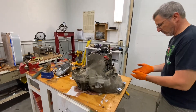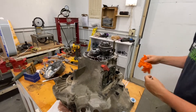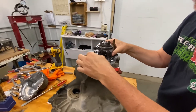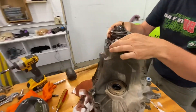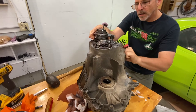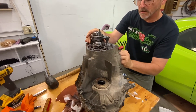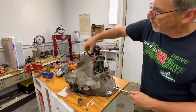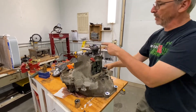I need to get the shift cover off. I'm supposed to get it in between two gears and then remove these two nuts on the input and the output shaft. To get it in two gears, I just had to move the shift lever up and now they're locked in two gears — that's going to hold it still. It's a 30 millimeter bolt.